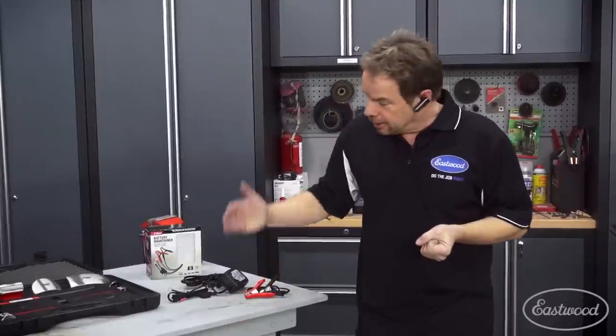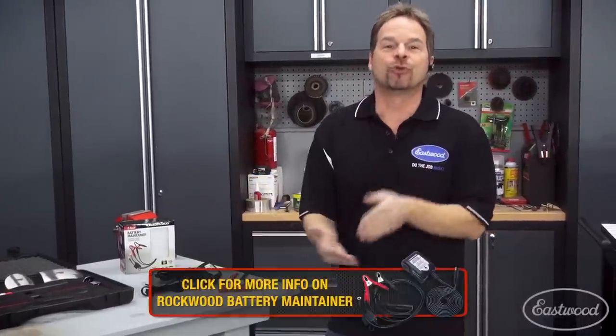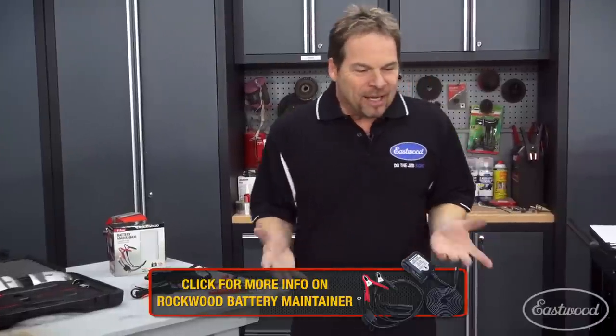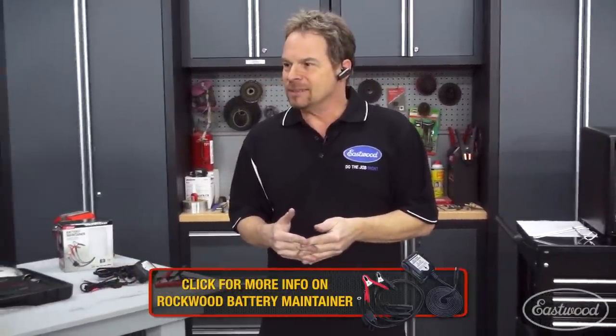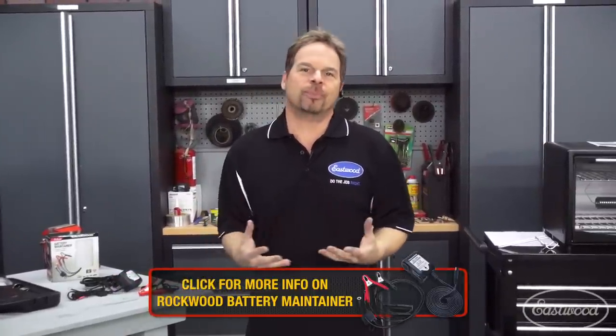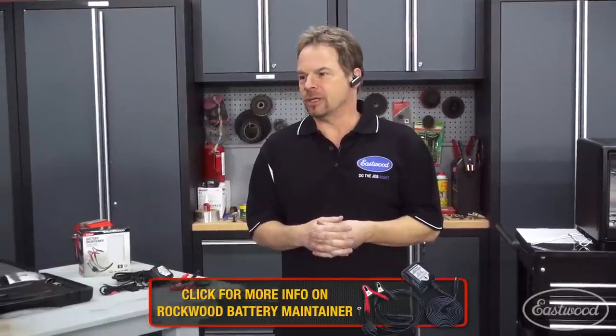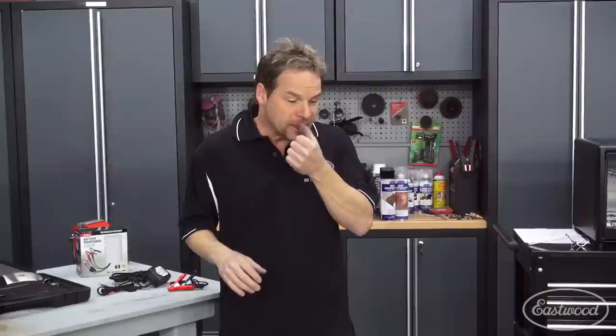So anyway, think about it, get it, hook it up, forget about it until the spring. I've had custom cars that kind of needed a little bit of help. If they sit for 6 or 8 months, if you've got a traditional battery, sometimes the battery just goes flat and loses its charge. There's an electrolytic draw sometimes, even if the circuits are perfect. So having a battery tender or a conditioner maintainer on your battery in storage over the winter, if you've got a fair weather vehicle, an off-road truck or something like that, just think about it. It's a great idea, great thing to have.